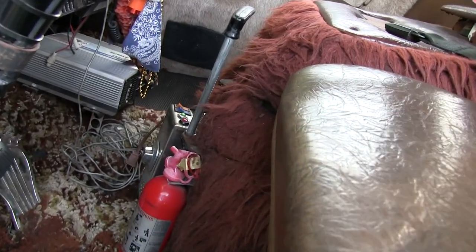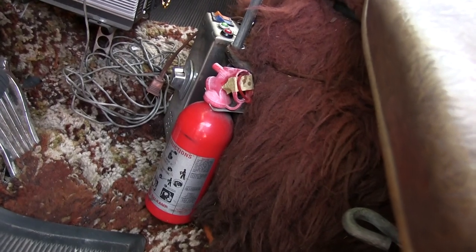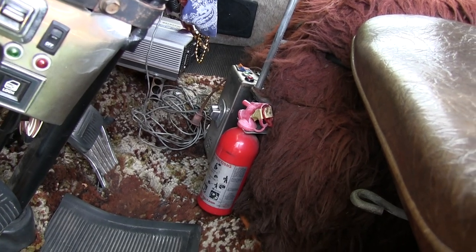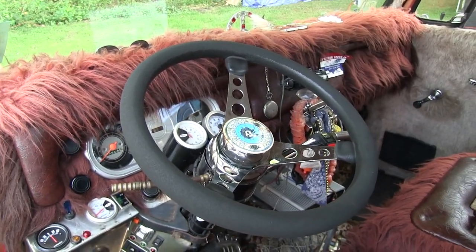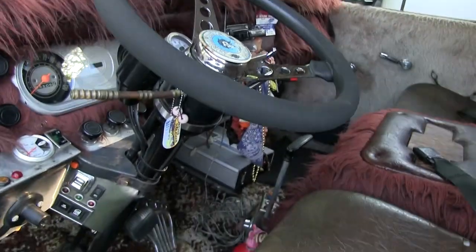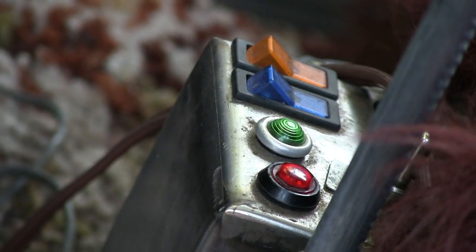I've got quite a few little gadgets in there. That's your CB down there. There's a CB down there, and that box next to the fire extinguisher is hooked up to the fan - when I'm driving down the road, the helper fan sucks in. But when I shut it down and park it, I reverse the fan and it blows the heat out the front, which evacuates the heat out of there a lot quicker. I also got an off switch for my gas line - when I go to park it, I shut the gas off and let it run completely out of gas so you don't smell all the fumes. Because these vans get so hot that the one barrel will act like a percolator and boil the gas right out into the intake until the bowl is empty. So when the fan's blowing out the front, if I go to start it, there's a switch down there, and a red light comes on and a blinker and a buzzer to tell me my fan's blowing the wrong way, otherwise it has the tendency to overheat when the fan's working against itself.